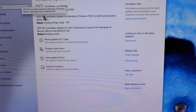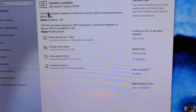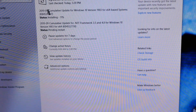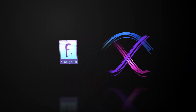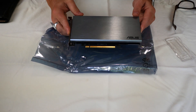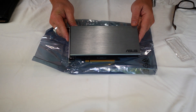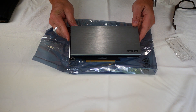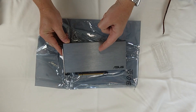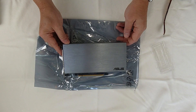Trying to shut the computer down to install the ASUS HyperCard but there's a Windows update to deal with first. We've decided to use an i9-9900K CPU and an ASUS Maximus 11 Hero Wi-Fi, which means I can't get four NVMEs in this RAID array because of the limits of the PCIe lanes on my motherboard.